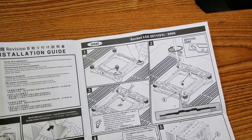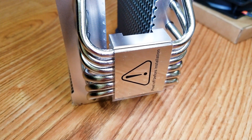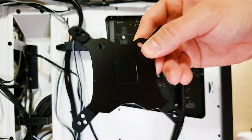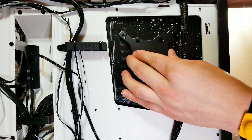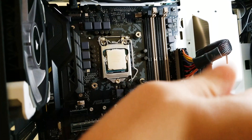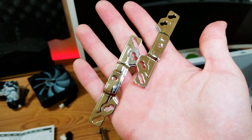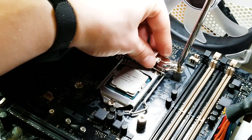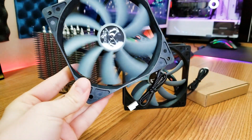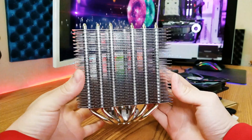What was a bit difficult is installing the fans once the cooler is installed. Before we install, I believe it would be easier to remove the motherboard from the case and install the cooler that way — I installed it while the motherboard was inside the case and had a bit of trouble. For the LGA 1151 platform, you need to place the black bracket — the biggest one — on the back side of the motherboard, then get the bigger screws and put them through the front side of the motherboard into the middle hole on the back bracket. The middle hole is for the 1151 socket; it may be different for other platforms. After that, get the two smaller brackets and the smaller screws. Place them perpendicular to the RAM slots or else the cooler will not fit well, then secure them with the smaller screws. At this point you can and probably should place the rear fan on the tower. Don't put the middle one yet because you'll need that space empty. You can also put a fan in the front if you have an extra one and a big enough motherboard.